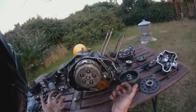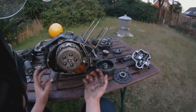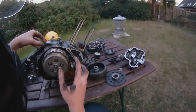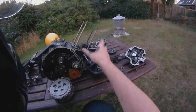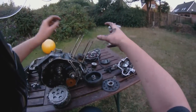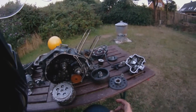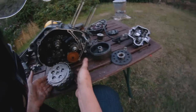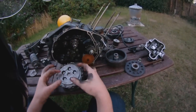That's what Betty's heart looked like. She's taught me a lot — I find that taking something apart and putting it back together, or just taking it apart and explaining exactly how it works, means I fully understand it. Now I have no fear in changing the clutch or other parts until I get into that central core. To recap quickly: you've got the fuel and air mix and the exhaust being timed by the movement of its own chain, always in the same place. The cams go up and down, fuel comes in, it compresses, bang, then it opens and the exhaust pops out — timed very accurately by the valves. That's the side of the engine that keeps running on its own, and then that raw power is picked up by the clutch basket; the inertia is held on by the flywheel, and transferring to the transmission itself is done through the clutch.